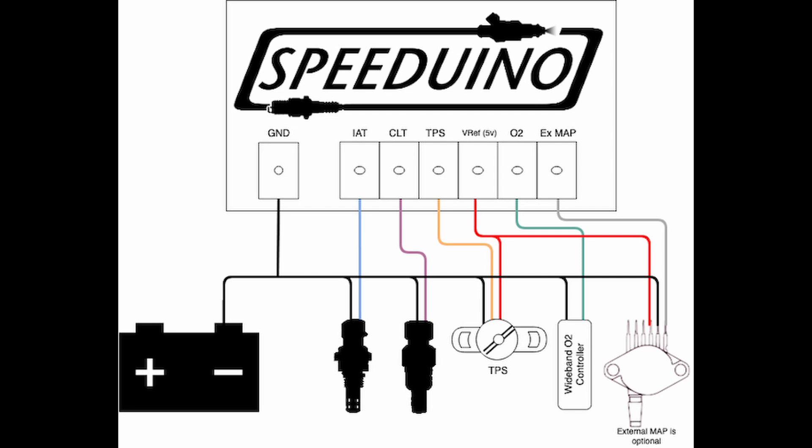You also need to wire up your wideband oxygen/AFR sensor. If you've already wired it to the gauge, those gauges typically have a 0-5V output and a ground. You wire that 5V output into the ECU's analog input, ground the minus, and then you have your AFR signal in software and can tune fueling. With the integrated MAP sensor that's present in basically every standalone ECU connected, the engine will run decently.